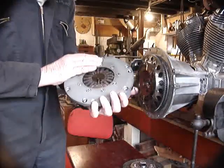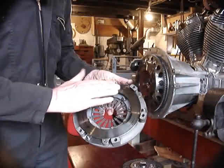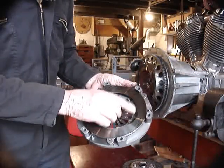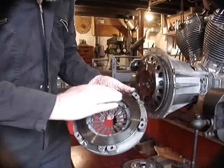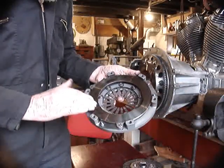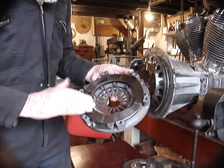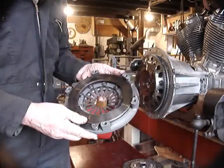The cover looks just like new. The plate is showing a few signs of blueing and discolouration, but that's quite normal. You can't feel any ridges on there, you can't feel any little bubbles or blisters — nothing. That will work perfectly and will go back in as it is.